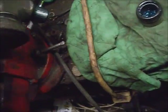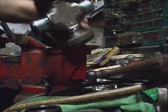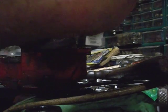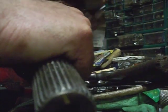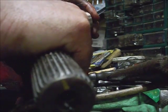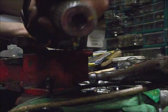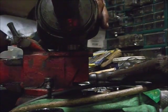Use both of your caps off. Spray some penetrating oil in these ears. Look for your alignment marks — there's one right through here, there's this one. So the yoke goes on this way. I'll fix one of the caps on.